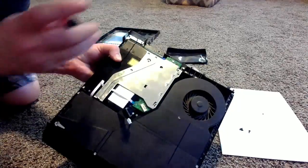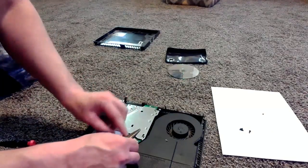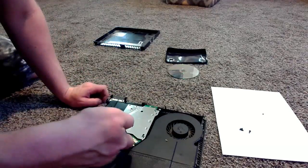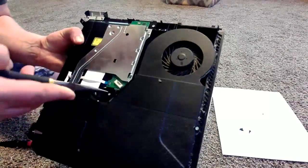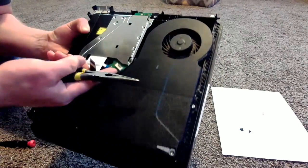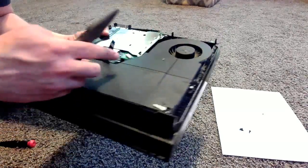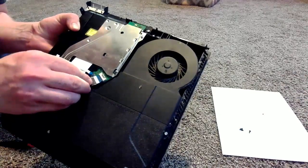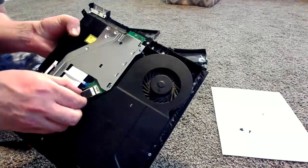Make sure you get this screw back down in here that was underneath that wiring harness — put that screw back in first before you reconnect the wiring harness. Don't over-tighten the screws, just tighten them until they stop. Now here's your little wiring harness — this might be the most difficult part. Take it with your needle nose pliers and wiggle it around in there. You'll find it as you're pushing — just wiggle it around and push it in until it snaps. After I get it guided in with my needle nose, I'll just use my fingernail to push it in the rest of the way, because you want to be very careful with that wiring harness. Then take your ribbon, pop it right in there until it snaps — you should hear it. Give it a little wiggle to make sure it's in place.